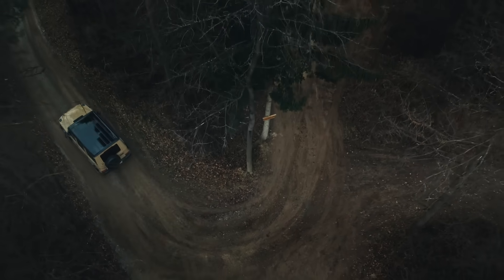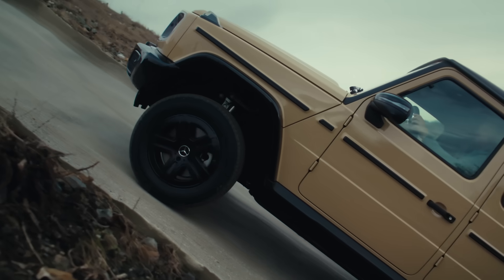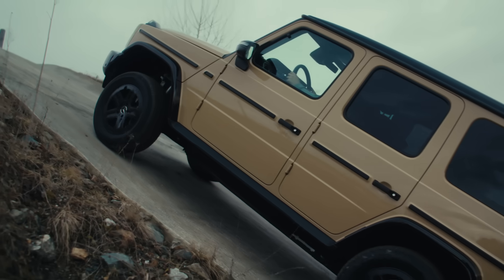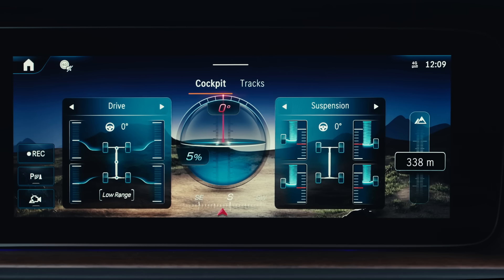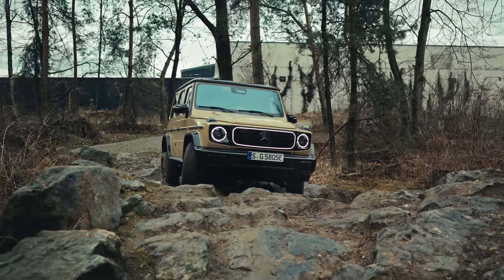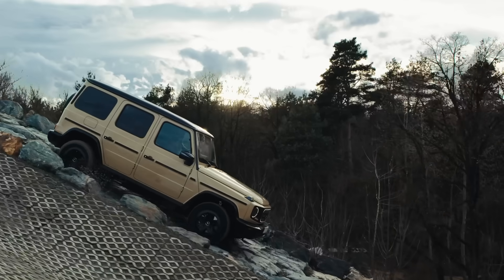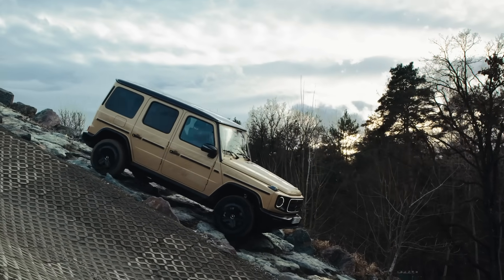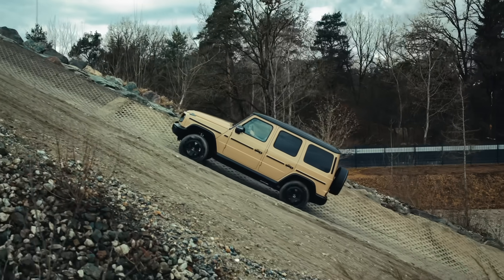Supporting the electric powertrain are four shiftable gearboxes. Each motor comes with its own low-range off-road gear reduction. That's why the all-new electric G-Class has not just one, but two gears as the basis for its unparalleled off-road capabilities. When the low-range off-road gear reduction is activated, the transmission ratio changes from 1-to-11 to 1-to-21, which leads to significantly higher torque, lower power load on the motor during slow off-road driving, and improved recuperation when driving downhill off-road. As a result, the vehicle exerts much less force and requires less energy when traveling uphill with low-range activated.